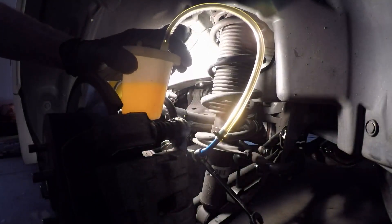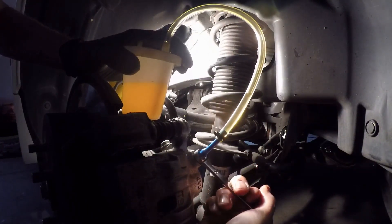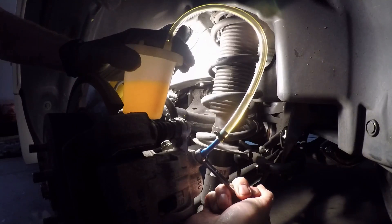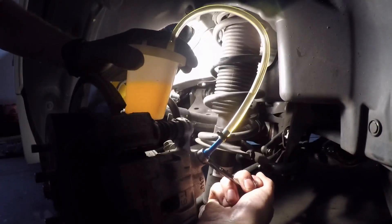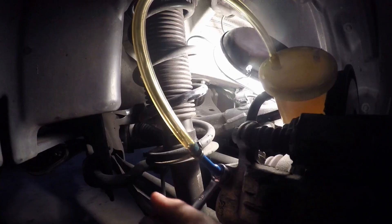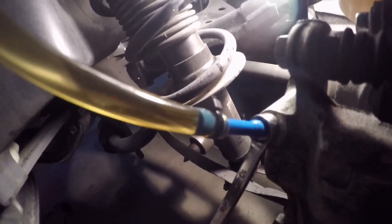That's the two fronts done — I got bubbles in both, that's good. Now left rear — pump it and hold it. Not too much air there. One more time — it's mostly the fronts. Holding... okay, this back was clear, nothing wrong with it. Now the final one — pump and hold. Nothing there. One more time and hold. All right, you can get out — thanks.